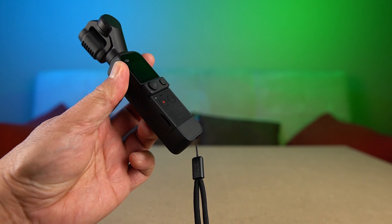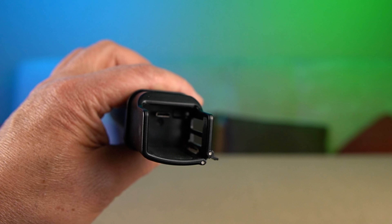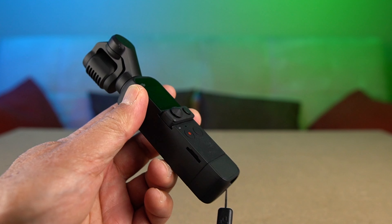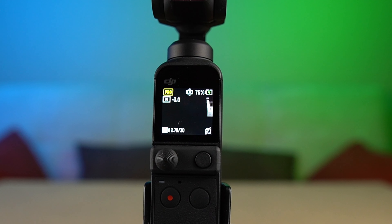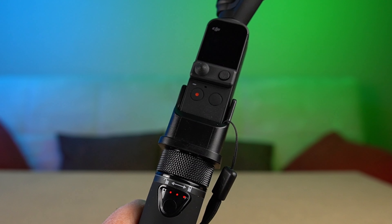For the Pocket 2, you have to ensure the base with the quarter-inch screw mount is removed. If you look closely, the receiving end of the plug connection is deeper inside the mounting base of the pocket when it's attached. When you look inside the charging mount, you'll see the small USB male connector. If you have the do-it-all handle, you simply remove it to expose the USB-C connector. Once you're connected, to start charging the Osmo Pocket or DJI Pocket 2, depress the charging button on the handle, and if your pocket is on you'll see the charging symbol on the top right of the screen. If your camera is off, you'll see the charging light blinking.